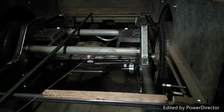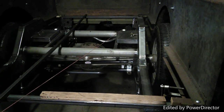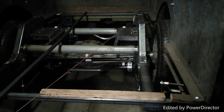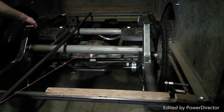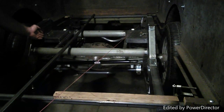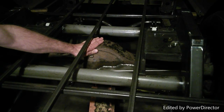You can see this tubing which is three-quarter by three-quarter and only a sixteenth thick - super light but nice and strong. By putting four of these pieces of one-by tubing together I'll have a nice grid structure to lay the steel plate on. I'll only have to cut out where the frame rails come up inside, and figure out something for the air inlet - maybe put that underneath. The wheel tubs will come all the way over, and the rest will all be one big sheet of diamond plate steel.